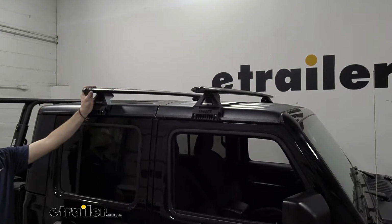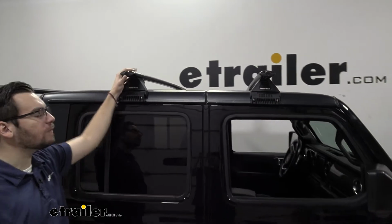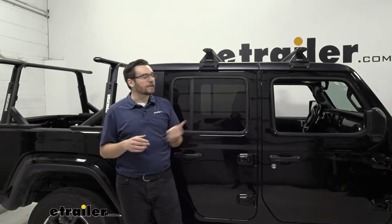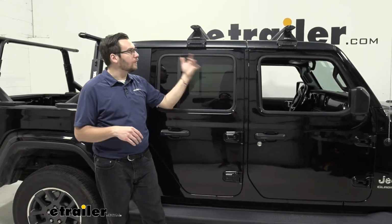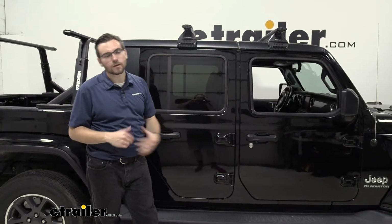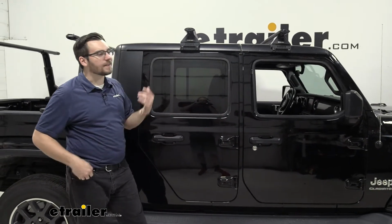We do have our Vortex bars, so we're getting that aerodynamic shape that we're wanting from these newer bars, of course. And it does come with a pretty decent weight capacity with 165 pounds. I think we're having an A-OK time throwing up almost any accessories we want here on the top of our Gladiator. And to that end, I would just go ahead and check your guys' vehicle's owner's manual guide to make sure we're not exceeding our own weight limit of our roof. Now, the only thing I was able to find that wasn't even really concrete was about 150 pounds, but again, that was on a Jeep Wrangler hard top. So again, let's do our own little research at home, but the big thing is let's be safe and make sure we're not overloading our Gladiator here. But again, we are going to have a very nice bar to start getting anything we want up on here.